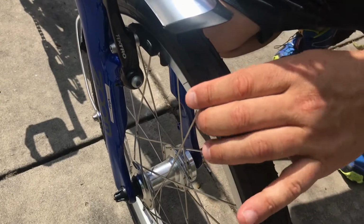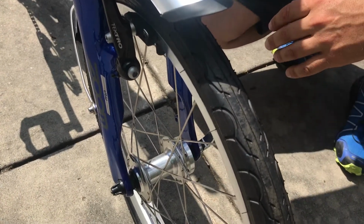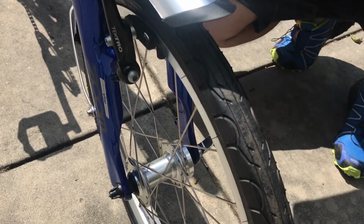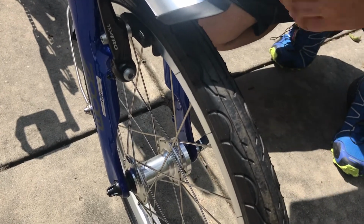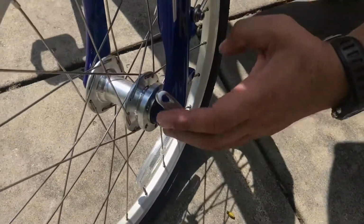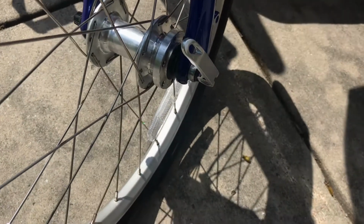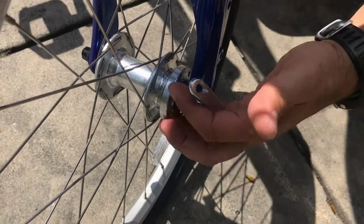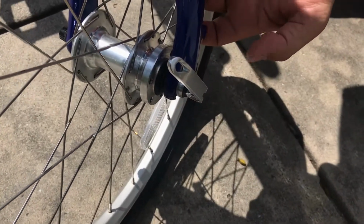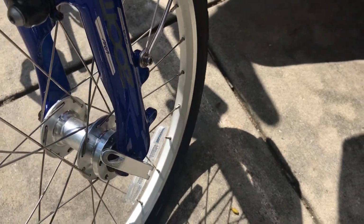You have the speed that you need by minimizing the push force that exists and increasing the force which has the pull dynamic with it. All right, as we move down, I'm going to turn this, and you're going to see we have a 6-bolt interface on the hub. So if you want to go with a disc brake, this bike is 100% ready for a disc. You just put the rotor on, the caliper goes right here with the tabs, and you're in business. So it's a very quick, easy operation.